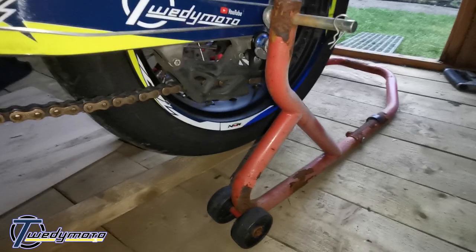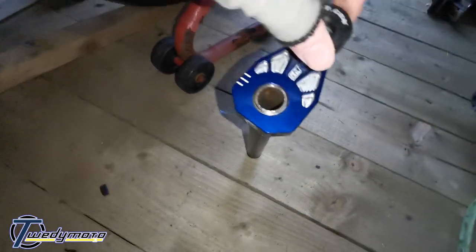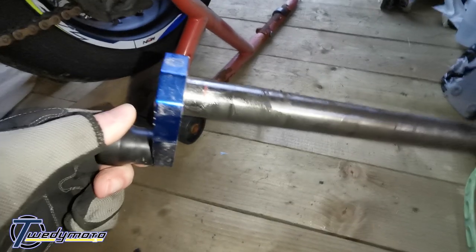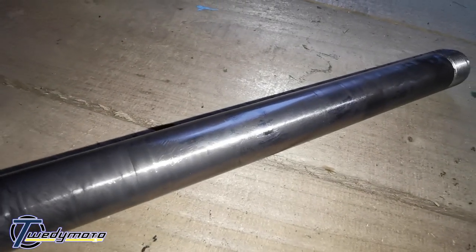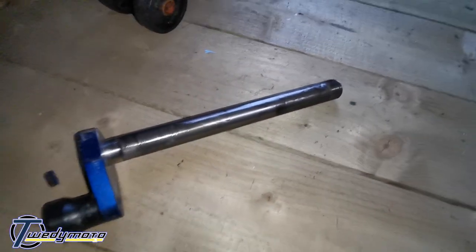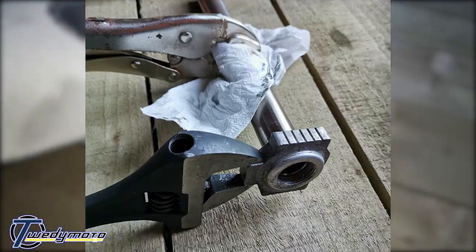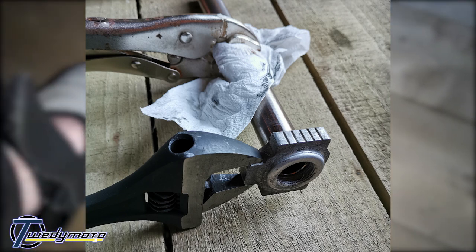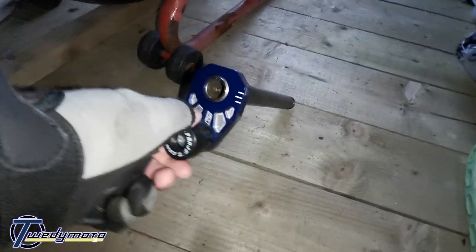If you're not actually taking the wheel out you can pop a bit of wood underneath the tire - it's only dropped a few millimetres so not too much. Now this is where I got stumped, because the original piece is actually threaded onto the axle and it wasn't exactly obvious how to remove it. I used a set of mole grips around here - you can see I've kind of scratched it a little bit. I wrapped it in some paper or cloth, put the mole grips on really tight, then used the adjustable spanner on the original block on the bit that sticks out and just cracked it off. Yeah, it's a normal thread - I just loosened it that way. It is quite tight because there's thread locker on it.